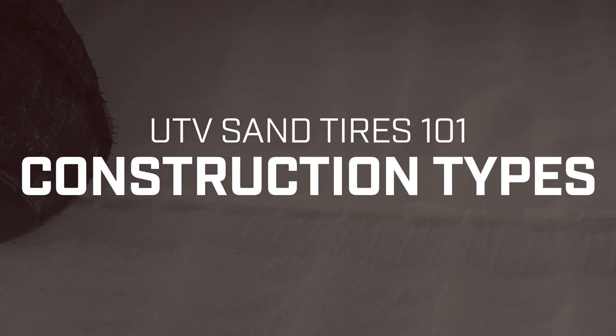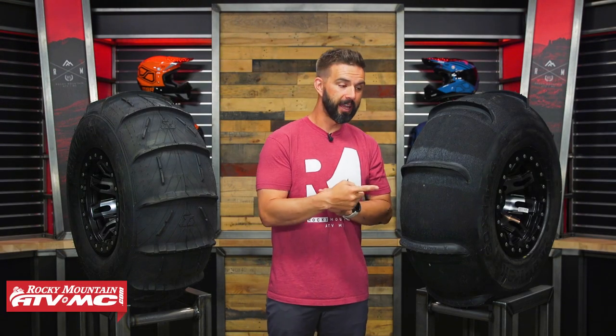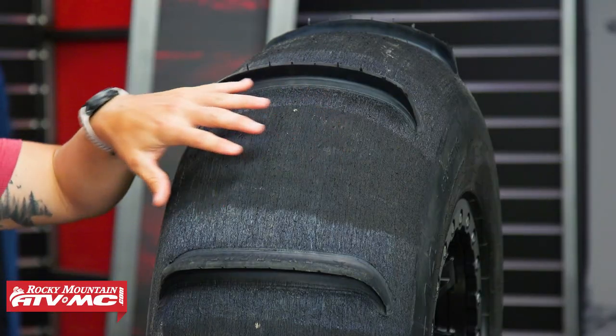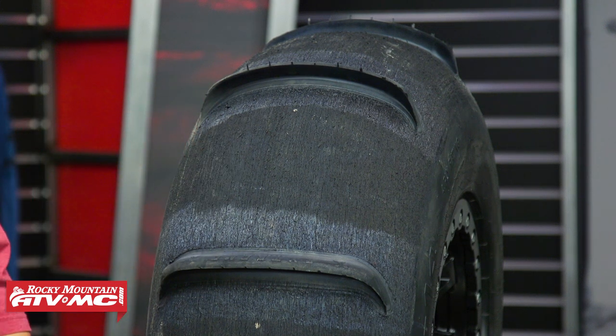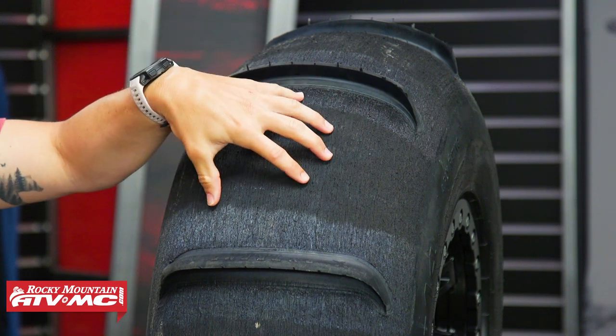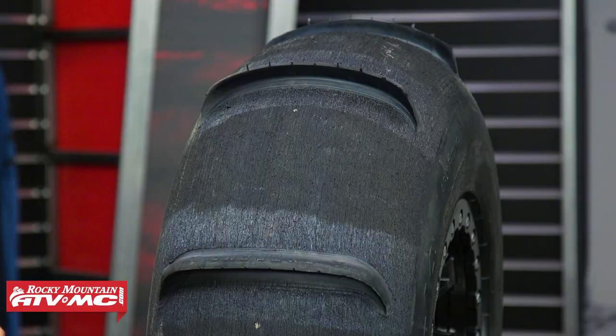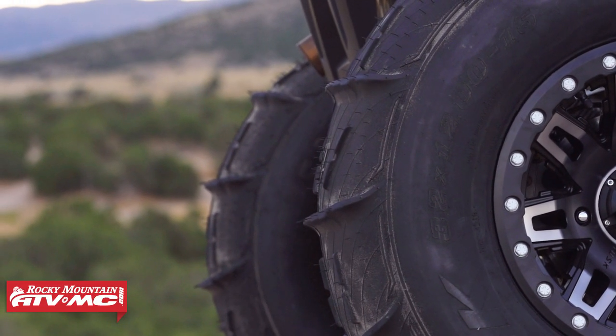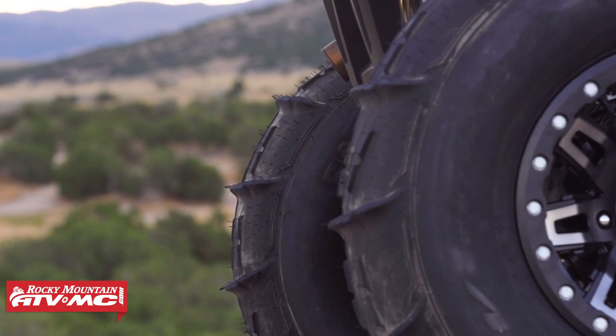Now, construction types. In sand tires there are two main types: molded and buffed. A buff tire is made by taking a regular molded tire and shaving off as much rubber as possible to make it as light as possible — maximizing flotation. Then the paddles are vulcanized back onto the tire. The advantages of a buff tire are that they're very lightweight; however, you can sacrifice some durability, and buff tires do tend to come with a premium price tag. Molded tires aren't quite as lightweight but offer a good blend of light weight and better durability, and in most cases give you the best value.